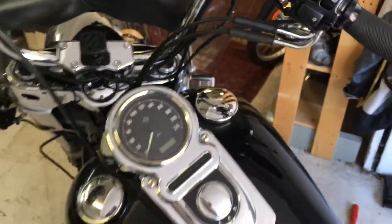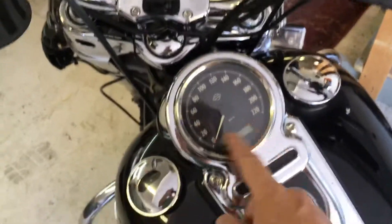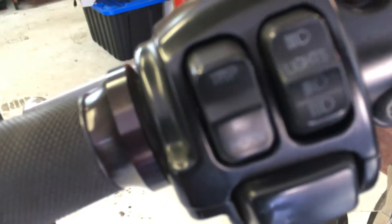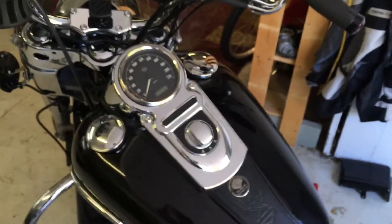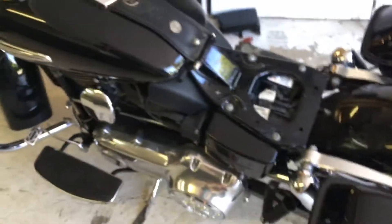You can see all that before the red light comes on in the middle of nowhere and you're totally screwed. I don't know why Harley doesn't have voltage as one of their information modes when you flip through the trip display — they don't, and it would all be there because it's all sent over the signal. But anyway, with this at least you can tell where you're going to lose your voltage, whether it's the battery or charging, or what's going on — at least you have an idea before you're stranded somewhere. Have a great day, goodbye.